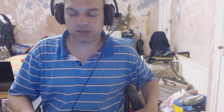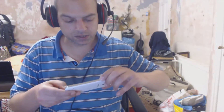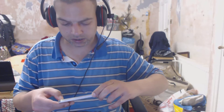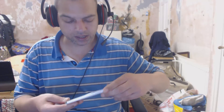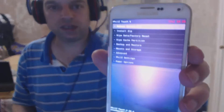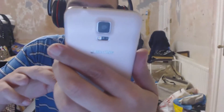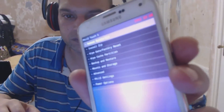I am going to give it a go just to show you, if I can get this right. I am not going to wipe my phone, but I will give it a go. So: volume up, hold power and home — hold these three. Let me do it so I can see what I am doing. Ok, I have done it. It has come up at the top there — you see. And it is going to come up with a loader. I want you to go down. It is the third one down — wipe data factory reset. You need to do that.